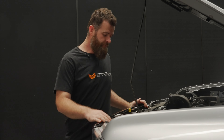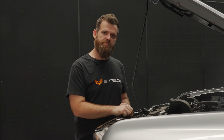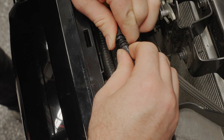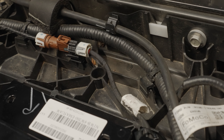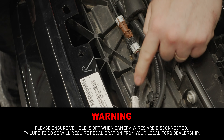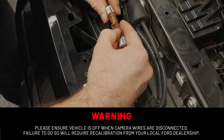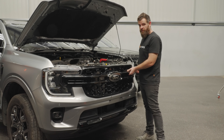Now that we've got our bolts out, there's a couple more things. We've got our washer jet for the front camera and the camera wiring. Right next to the bonnet latch is your little Christmas tree clip and the little squeezy clip to disconnect the water hose. Over the other side you'll see a brown electrical clip. There are a couple of little clips that hold it down to the radiator subframe — pop them up, then press the brown clip together and separate the wiring. Let's get this grille off now.